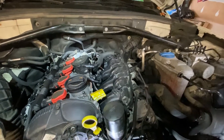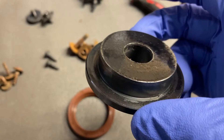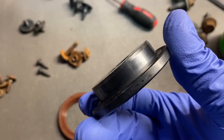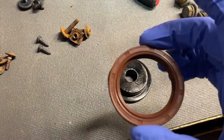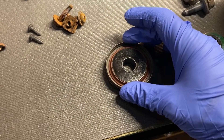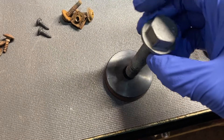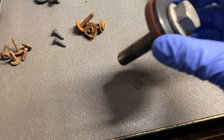To reinstall the seal, you'll need a special tool that pushes the seal into place, or you can do it by hand with a mallet — some people use a piece of two-by-four. I prefer to use the dedicated tool. Flip it, take your new seal upside down, insert it, put the tool in place, and use your original harmonic balancer bolt, which will push it into place when you tighten it down.